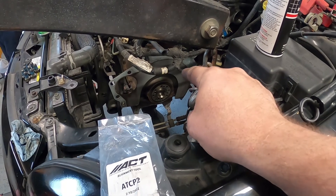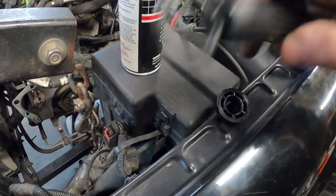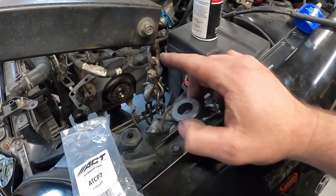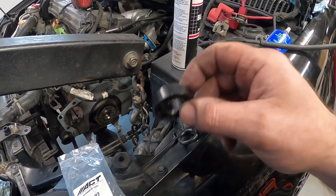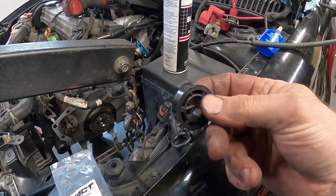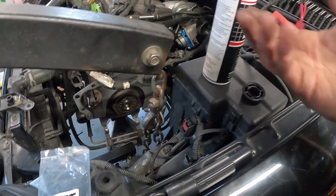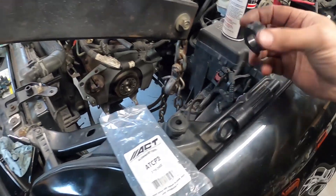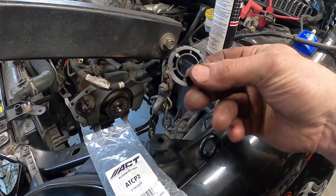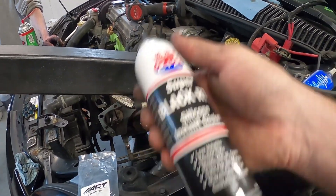The back of the crank is all nice and clean. These clutch kits come with the tool for centering - it's kind of like a pilot bearing, what you need to help center the clutch. I usually put a little bit of silicone on here to help hold it in the crank. They can bounce around and wear from hitting but it's plastic, breaks into little pieces, doesn't damage anything. I do this so if you ever have to take it apart again - say your rear main seal leaks - you still have your tool and can line your clutch back up without needing to order a new kit.